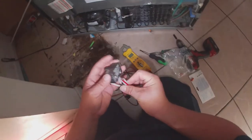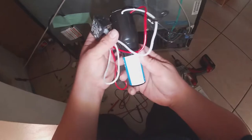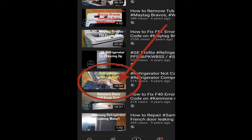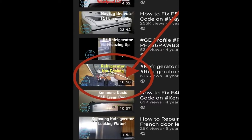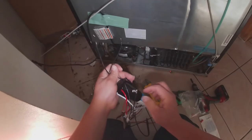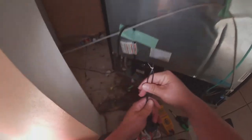The one that brings connections going to those two terminals is the one you'll need if your relay includes a capacitor. Sometimes relays don't bring a capacitor — there's a different diagram for that. If you want to test the compressor, look for that video on my channel where I show how to test the windings by setting the tester to ohms. But you have to own a tester — a link is in the description. The terminals go to the compressor, and the black terminals go to the power. Just follow the video and you'll be able to do this repair yourself.